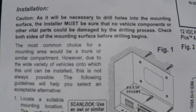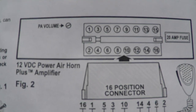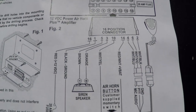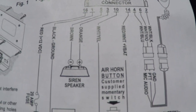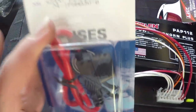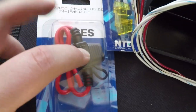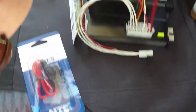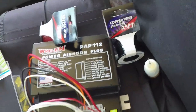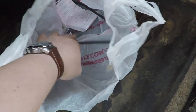There we go. I'm going to show you the diagram it comes with so you can see what we're actually going to be doing. I'm using a GoPro so it doesn't focus great up close, but just to get a quick overview of the diagram. Here's the rest of what we need: we got an inline fuse right here, and then we got the fuses — it's a 20-amp fuse. That'll stick right in there, and this will go between the battery and the red wire. Then we got 25 feet of red wire and 25 feet of black wire, and I do have some shrink tubing as well.